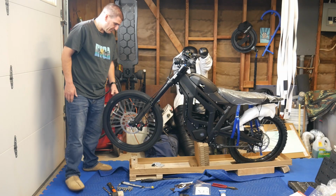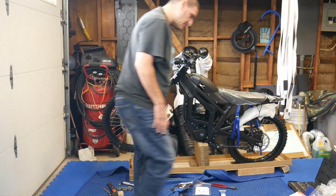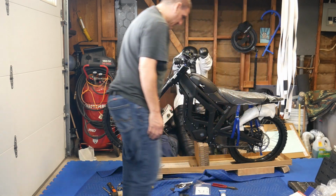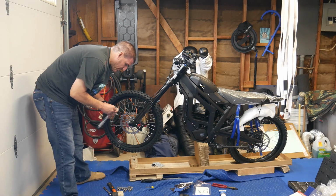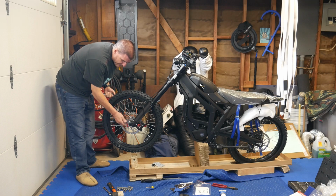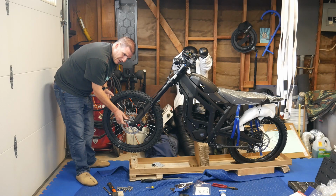that's normal. So now we're going to tighten the pinch bolts. Pinch bolts are going to be 10 Newton meters, and those are number 5s. So the pinch bolts, remember, you don't just first tighten them by hand. Don't over tighten pinch bolts, and don't tighten one side. Like, for example, there's 2 on each side. Don't tighten one whole side at 10 Newton meters and then do the other one, because what's going to happen is one's going to be loose, then the other one's going to be loose again, then you tighten one, you can't do that.